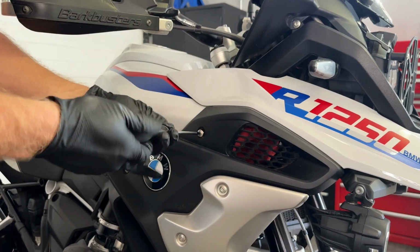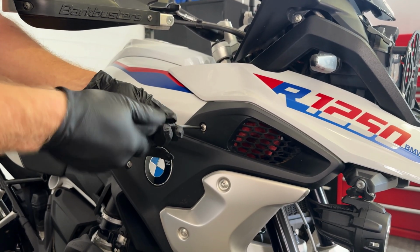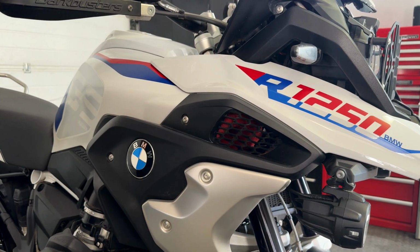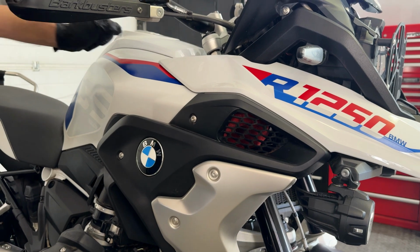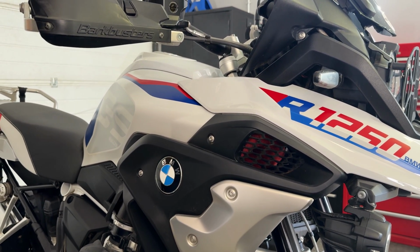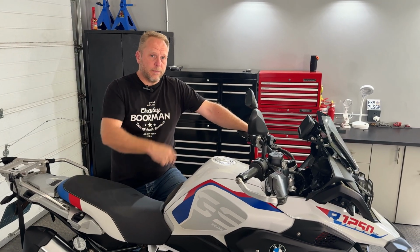Okay, last screw back in on the panel, and then she is good to go. And down in the ram tube, you can see a nice clean air filter sock from Unifilter. What we're going to do next is the main air filter. For that, we've got to take the seat and the tank cover off. Okay, now we've done the filter socks, the pre-filters in the ram tubes.